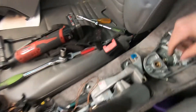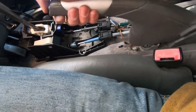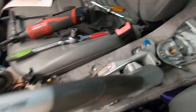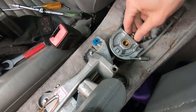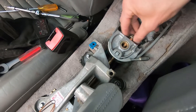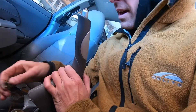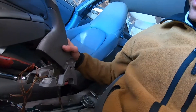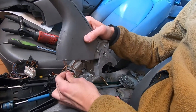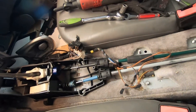Now I've got the e-brake loose. I had to undo these nuts to give it some slack so I could pull it up enough to get to the bolt underneath — until I lifted it, the bolt was hidden. I'm going to take this all the way off. This is the cable that goes to the parking brake — to the rear wheels, emergency brake, parking brake, however you call it. We have one connector here for the parking brake sensor. Now with the parking brake lever out, I'm exposing more of the shift cables.